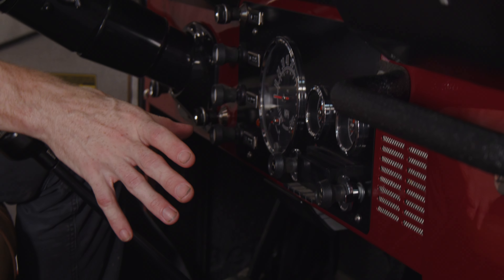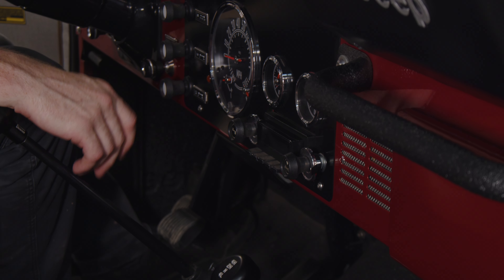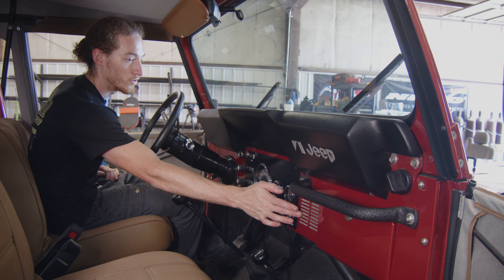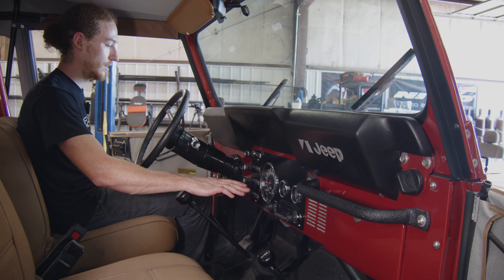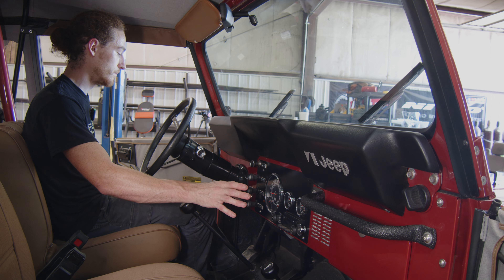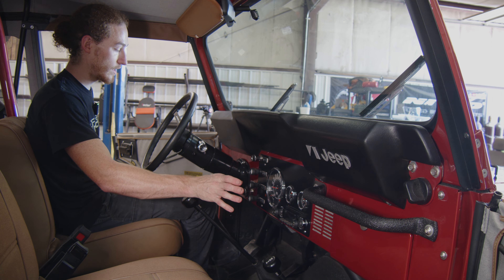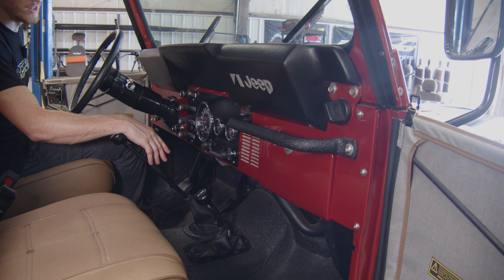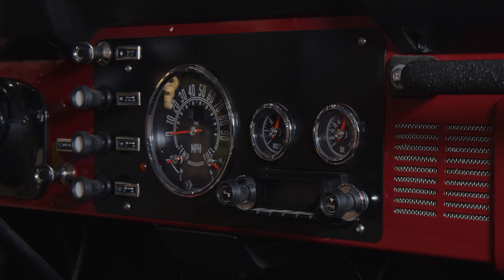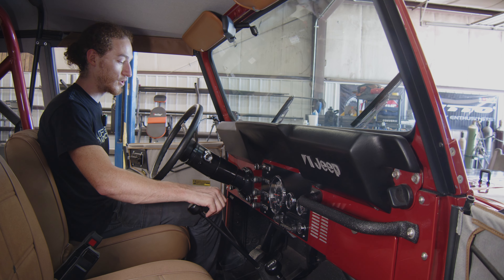This looks like a factory radio — it's not. We've got Bluetooth and XM radio, plus your typical AM/FM. Super cool unit. This is the original dash; we had gotten a replacement dash but it didn't fit everything very well, so we went back and had the original dash painted. It only had one speaker hole, so we put one really good Kicker speaker in it with a nice mesh covering so you don't see the tweeter built into it — otherwise it would stick out because it's bright yellow. It actually has really good audio for a single speaker, but this is a very small vehicle and you don't need a whole lot.